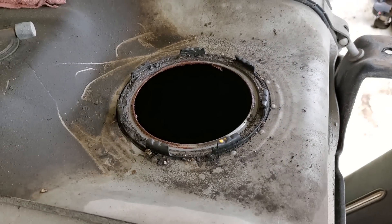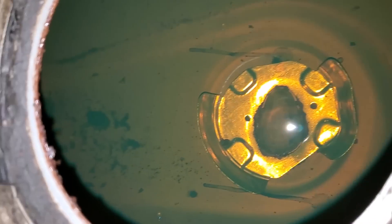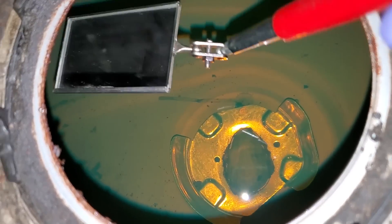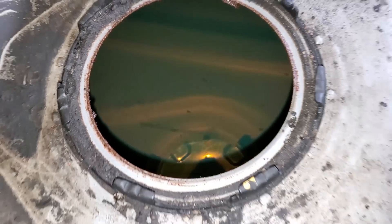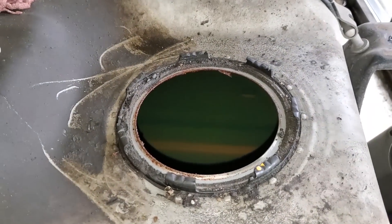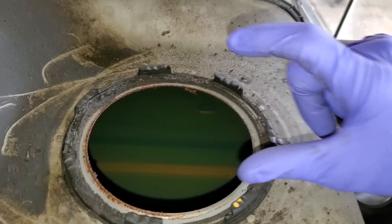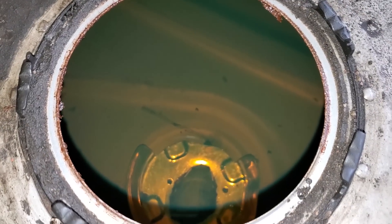I had to get okay from the customer to remove the fuel tank. When I took the fuel tank down, I automatically knew right when looking at it that we got a serious case of rust. Usually what I find is the roof of the tank is just completely rotted. The environment that the top of the tank is in — we remember diesel fuel is hygroscopic, so it normally wants to draw water to itself. And when we have that level of air on top of the fuel, that environment in there is not conducive to keeping the tank from rusting.